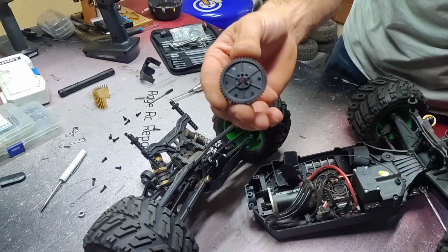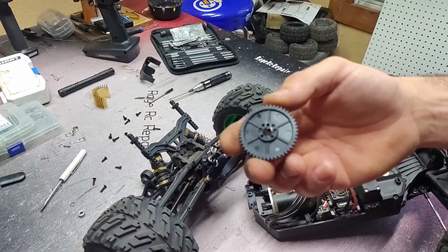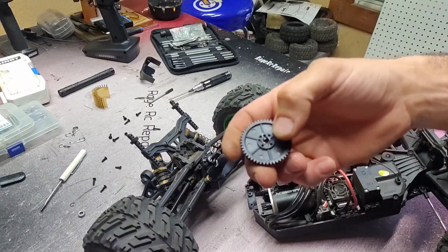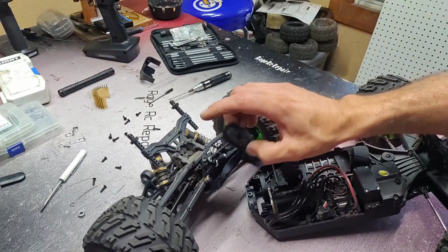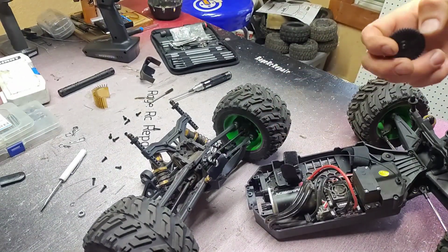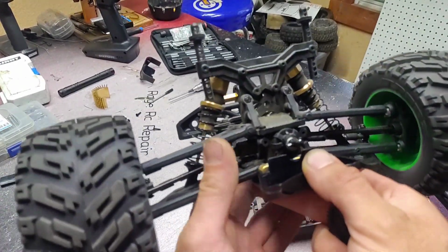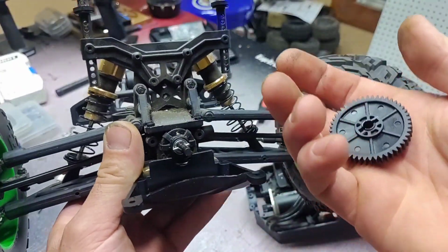And there's a slot right here in the plastic part of the gear, which you can see, somewhat difficult, but right there's a slot. It's this way. Make sure that is lined up with that pin right here before you slide it back on. And I'll show you what I mean. So in the event that this was a used gear or a new gear, I would be throwing this one away and putting a new one on it.